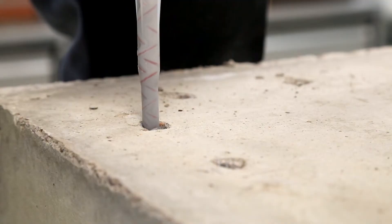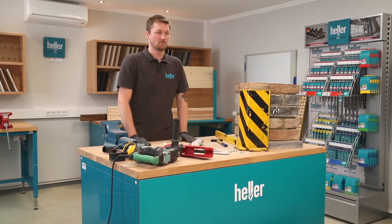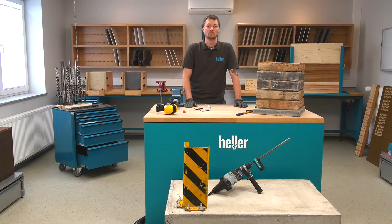You can install the epoxy right away, taking care of the instructions of the manufacturer. And use the bumper as a template again to install the threaded rods into the epoxy. Wait before tightening the nuts, because otherwise you will extract the bolts from the epoxy.